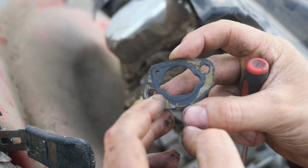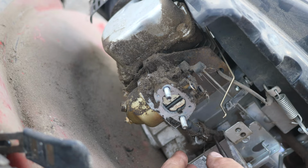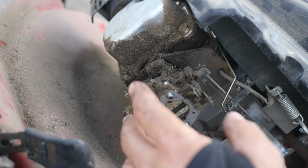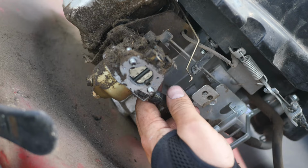All right. This guy should start coming off here now. I've got it tilted upright to keep the fuel in the tank. It'll actually help keep it back inside so that there's no fuel to come out. It's a good idea to unplug your spark plug so you don't bump your blade, or somebody comes up, little kid or whatever, plays with the blade. There's a chance that you could start it by moving or turning the blade. So it's always a good idea to unplug your spark plug. As you can see there, unplug it and pull the boot away to the side, because there's still a chance of it starting if the boot is anywhere near the spark plug.